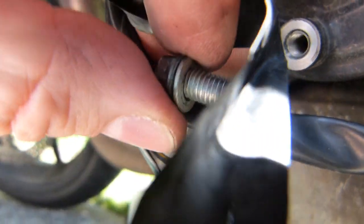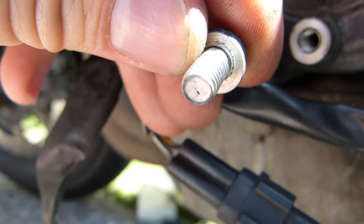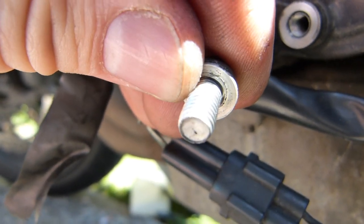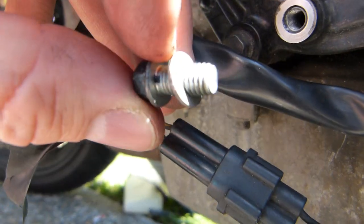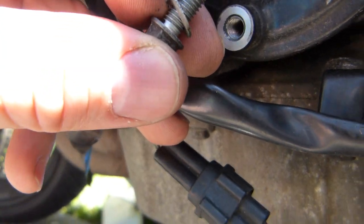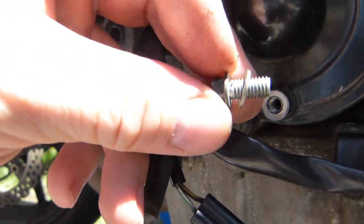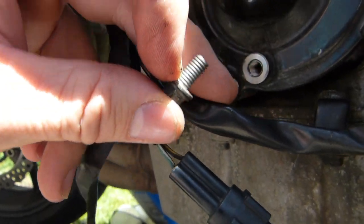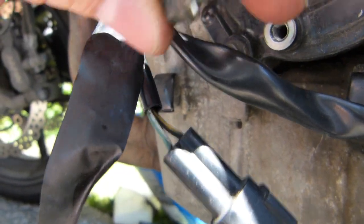Okay, so that's how this seals, because the threaded connection is not watertight at all. So if you find a replacement washer, the manufacturer recommends that this washer be replaced with a new one, so that it does not get deformed twice and potentially leak. But if you want to take your chances and reinstall it, hey, if it doesn't leak, it doesn't leak. But if you already have fresh engine coolant everywhere in the system, and it does leak after finishing and installing everything, if you take it out, you're gonna leak out some engine coolant while you replace this washer. It's not a big deal.